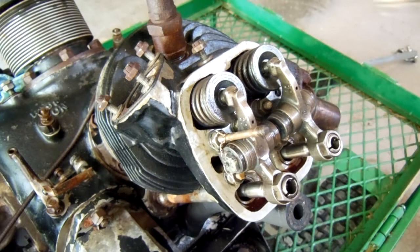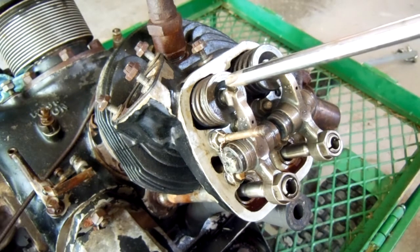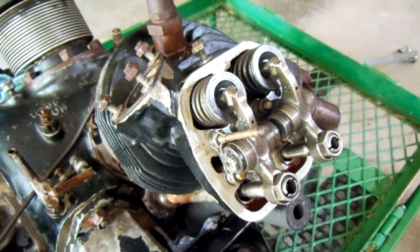I've already gone ahead and checked the clearance on this valve and it's good to go, so we know that valve clearance isn't the issue here. But I should also mention that sometimes you can get carbon or some other foreign material down in between the valve stem and the valve guide, and this can not only cause the valve to stick and the resulting blow-by, but it will also throw off the valve clearance when you go to check it, so be aware of that as well.